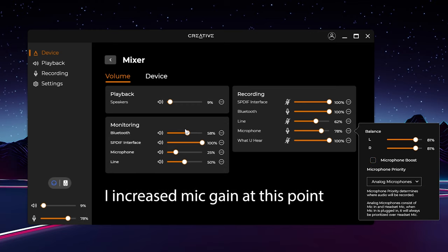And lastly, the bugs and gremlins. What's weird is the pops this unit makes — when you plug in a headset or headphone, I get a popping sound, and IEMs are especially sensitive to that. They use a series of relays inside but there's no extra filtering preventing that switchover noise from reaching your headphone driver. It is really bad on PlayStation 5 — if you're wearing IEMs or a sensitive headphone and you shut down your PS5 while this is running, the loud pop can damage your ears or potentially damage IEMs. If you're using this for PS5, turn it down, unplug your device first, or at least power off the X5 first to minimize how bad that power-off sequence hits.